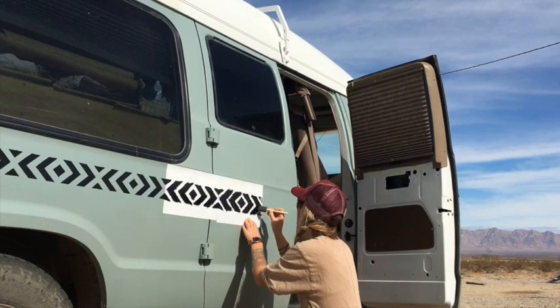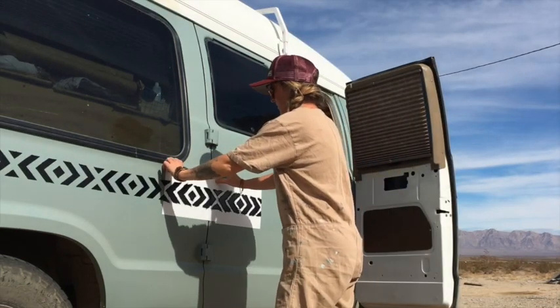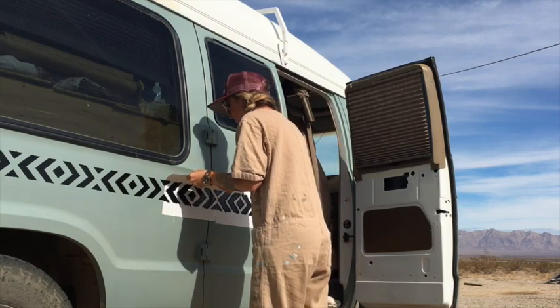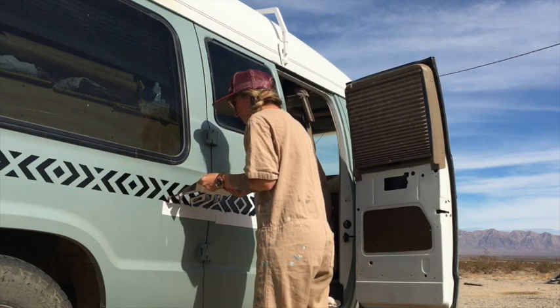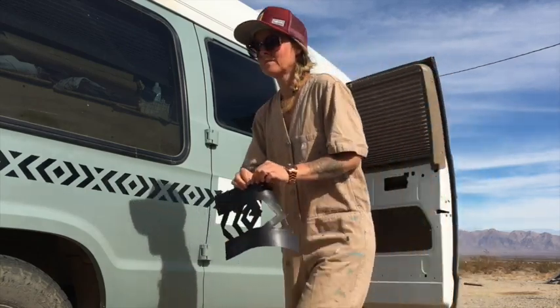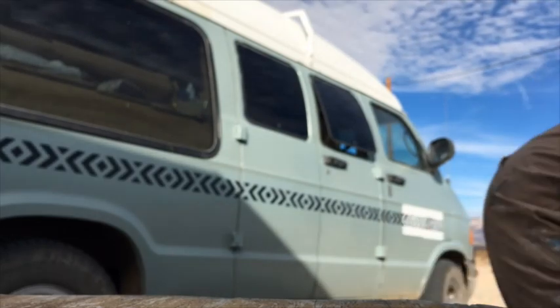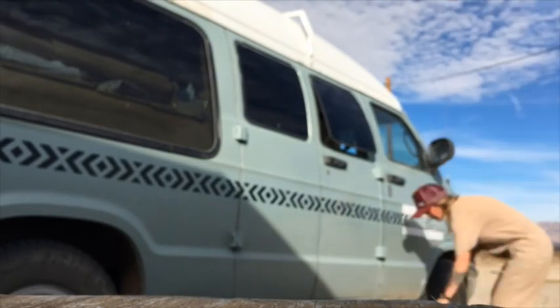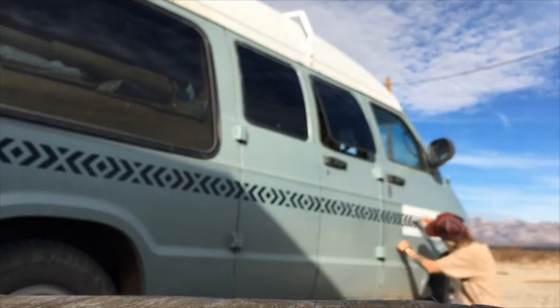I'm going to show you an image of it in a bit — I might have to go in with a little artist brush later and fix it up. Removing the stencil: I leave the stencil on the van until the paint has dried a little bit, because if I peel it too early, the gooey paint on the edges will peel out and feather the paint. Having more than one stencil helps so I can continue the project anyway. Not mad at it — it went all right. But as you can see, I was definitely left with a bit of a wobbly edge, which you can't see at all from afar but close up it shows. Just to disclaimer again: I am not a professional painter and this paint job is fairly new, so I can't tell you if this is going to hold up for a long time. But the paint job came to about $250–$300 instead of the $3,000–$5,000 that professional paint jobs cost.